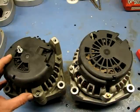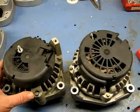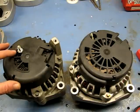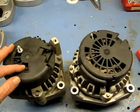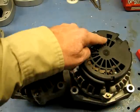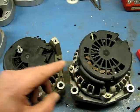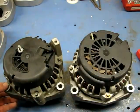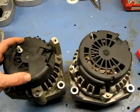There is also a small AD230 105-amp unit, just like the CS130d, and here's how you can tell the difference. From the side, the AD series looks similar to the CS130d. The big way to tell visually is the rear cover: you'll see three slots or a half-moon slot on the CS130d with a battery post at one end. The AD series has a whole bunch of vented holes — both the AD230 and AD244 have all these vented holes.